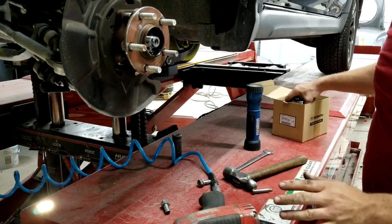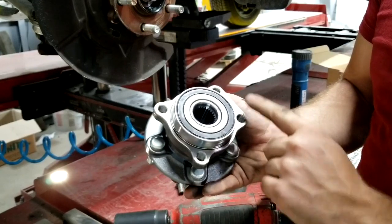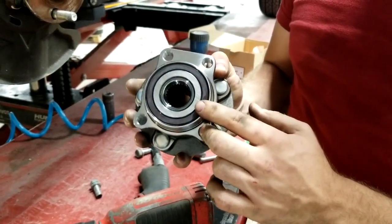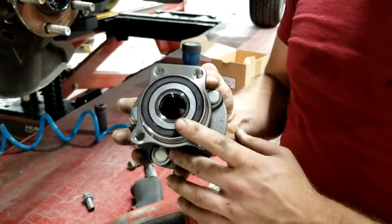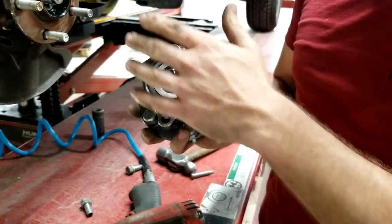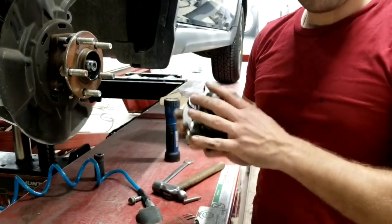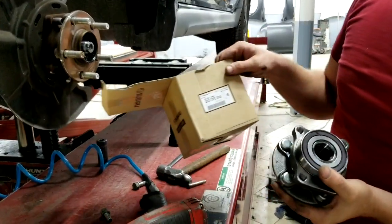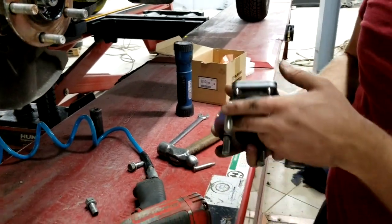Now I'm going to show you the brand new wheel bearing hub. As you can see on the back there are four holes that hold it in place. This is the magnetic ring I was telling you about. If you get an aftermarket wheel bearing, there's a big chance this magnetic strip is not going to work. If I take a flat-tip screwdriver and touch it, I get a little magneticity on here. On aftermarket bearings it often doesn't work, and then you start driving and your ABS light and traction light kick on. I recommend an OEM wheel bearing — it's a little more money, but I'm going to post a part number for this vehicle in the link.